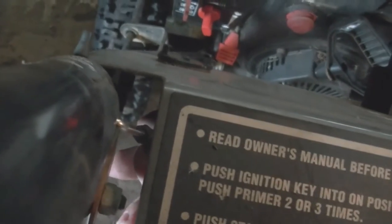Okay, here we go. You see the pulleys right here - down here. Sorry about my hand being in the way. All you have to do is loosen one bolt, take the other one out, and the whole system will lean to the side. That way it gives you room to go between the handlebar and the fastener for the pulley. You can see where the nuts are right here. This is actually an adjuster.